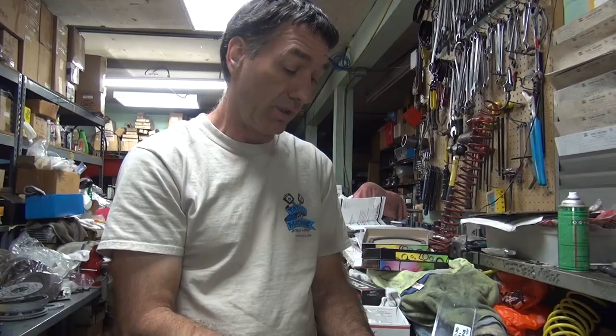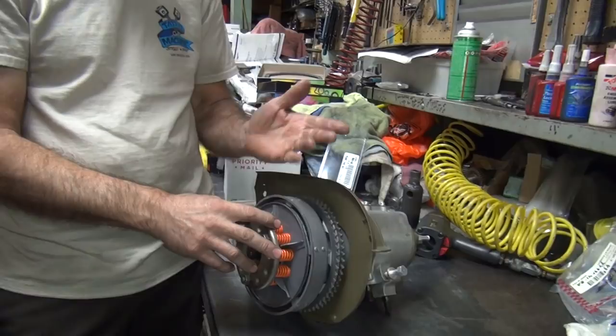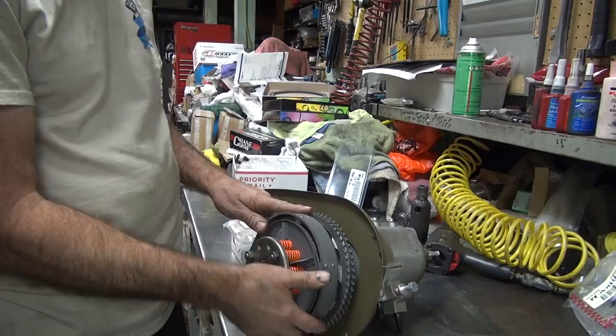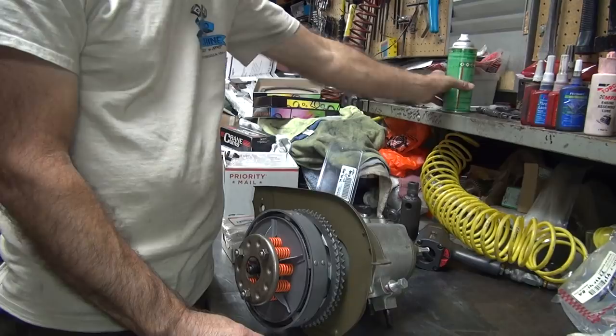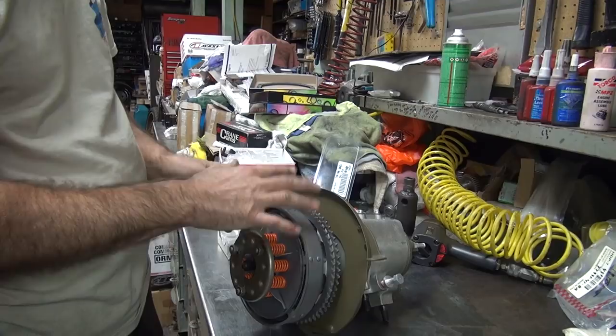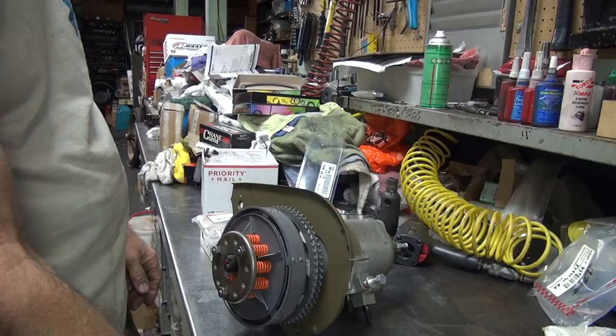It also makes the rocker clutch easier to work. It's less wear and tear. The lightest tension you can run is the least amount of tension on everything, so it saves parts. So you adjust them. If you don't want all the rust in here, you can put a little paint on this thing like this, or put a little oil on it, WD-40, CRC, whatever. If you want, we can douse it with that so it won't rust. When you get the oil in here like you're supposed to run, it should have a light coat of oil inside this whole thing. When the chain's lubricated correctly, this will have oil on it. You don't have to worry about it.